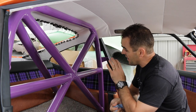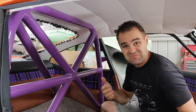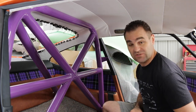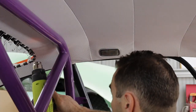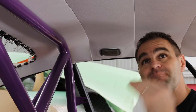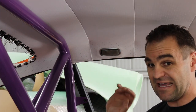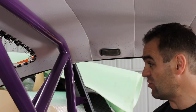Now I think it's a good time to go through and actually clean up the headliner. There's lots of gum left on the headliner from the adhesive that's come through it. So I'll go through and tidy that all up, and then I'm going to hit it with the heat gun using the same trick as I used on the seats and see if I can get rid of some of these last little bits of wrinkles. That worked quite well. The only thing I had to be really careful of — there's a bit of a leather grain pattern in this vinyl headliner, and if I let it get too hot, the leather grain pattern actually sort of disappeared and it looked like it was starting to melt. So if you're going to do this on your own headliner, just really be careful because you will melt it really easily.